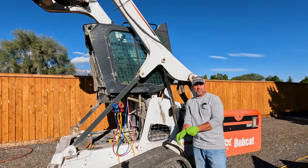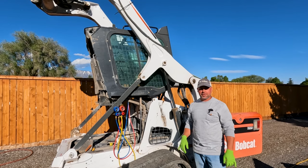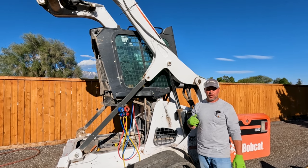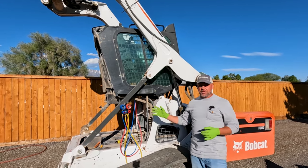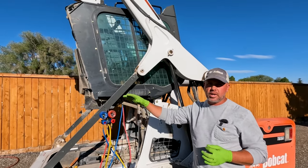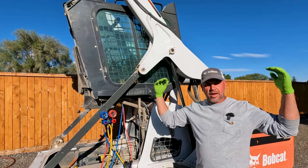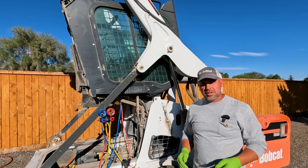It's starting to get hot this week, and this is the time of year when I get a lot of calls for people wanting me to come out and check their AC. "Can you come out and put a little Freon? My AC's not blowing cold enough." Usually what I find — and I do a lot of these systems — the majority of the time it's a lack of airflow going through the actual evaporator getting into the cab. We're not getting good air out of the vents, and everybody just seems to think they just need Freon.